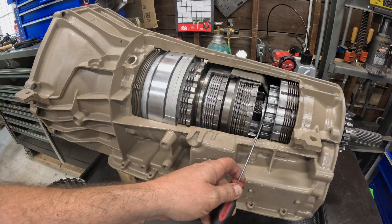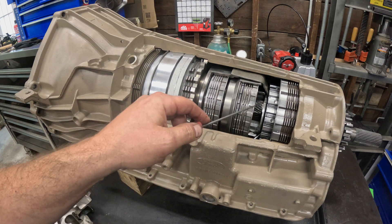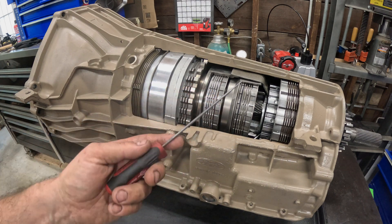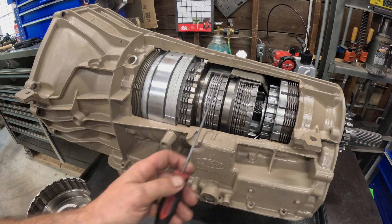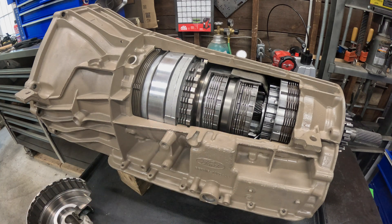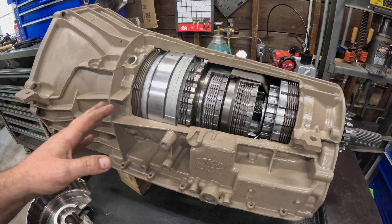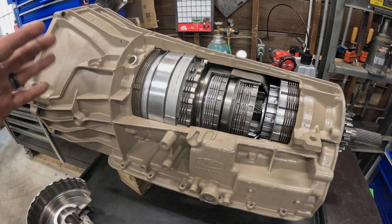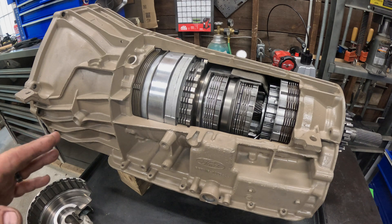The rear section is actually fine other than it also has a three-pinion aluminum planetary carrier in there. The drum is untouched — it's a fine drum. And then there's a stock six-friction pack in the rear. Everything is sealed. Every piston works; I can engage every single piston and every clutch pack. It's kind of cool — it's a good way to look to see how things interact with each other.